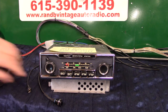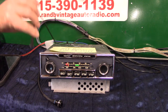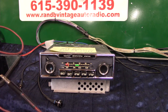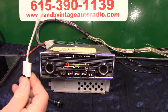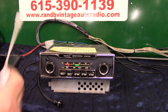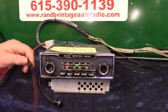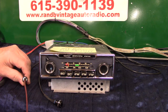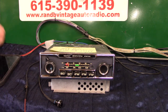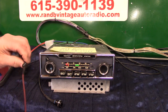Auxiliary in — you get a two-piece cable. This one plugs into the back where it says aux. You can hide it wherever you want to in the car so you don't have to see it, as long as you know where it is. And a male-to-male cord to go to it. You can find adapters for newer phones on eBay or at your phone store since they don't have headphone jacks. But you can plug in CD changers, XM radio, satellite radio, and your phone — anything that puts out a signal.